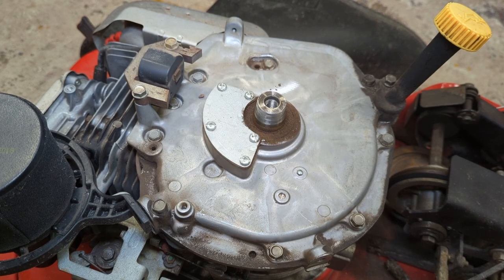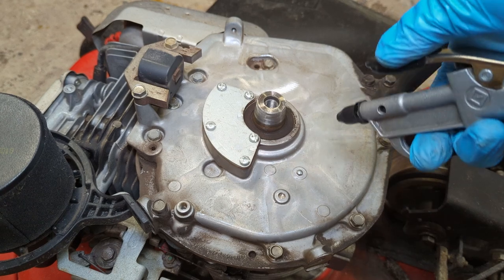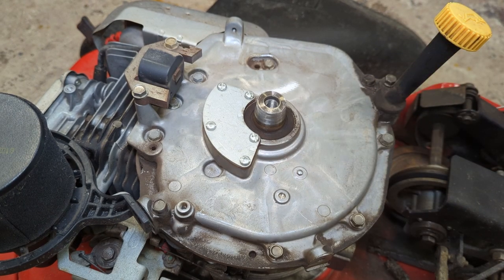I don't see any evidence that the breather gasket is leaking. Maybe a little bit, let's see. No, that's not bad. I mean, all seals are going to seep, right? Nothing's ever going to get 100% seal. And quite honestly, that could just be dust. All right, so I think we're just going to proceed as originally planned. We're going to swap out that sump gasket. I did order an O-ring for the dipstick tube as well. Figured that was a good target of opportunity.